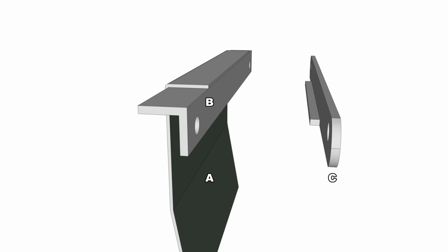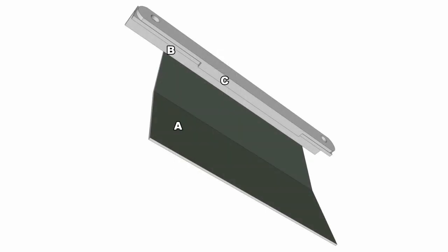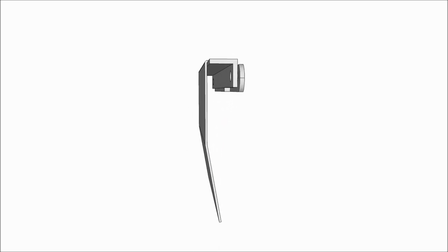The one-sixteenth scrap aluminum, marked A, is there just to provide a finished look so you don't see the inside workings of the sliding door through the door handle opening. It will be covered with the same fabric as the door panel. Part A will be riveted to the top of part B and installed inside the sliding door. Part C, the visible piece, is bolted on top of the door panel, with the bolts sandwiching the door panel. The door panel will be sandwiched between parts B and C. Looking from below, you can see the void for your fingers inside the sliding door between the back plate A and the visible handle C.